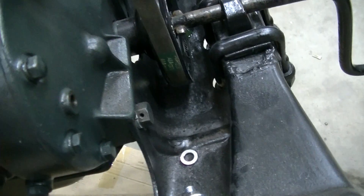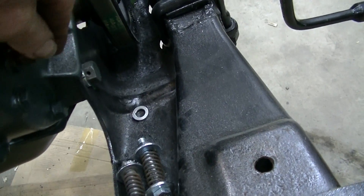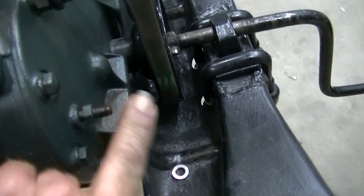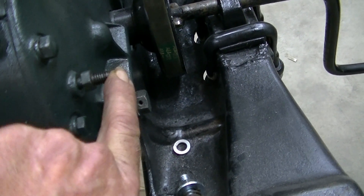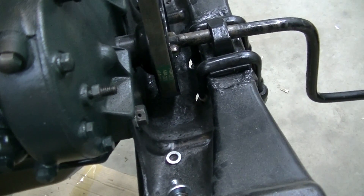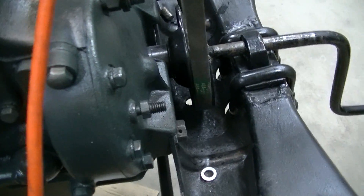This little bolt — you'll see it's sticking out the front of the engine. If you take it out and put it back in the opposite way, then as you're turning it over very slowly, when you have compression you keep turning until you get to top dead center, and this bolt will drop into a small detent on the timing gear. It's important to have it fall in when you've taken all the slop out of the gears — come forward to get that pin in, and that'll take all the slop out of the timing gears.